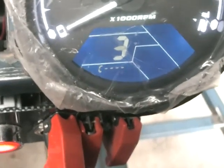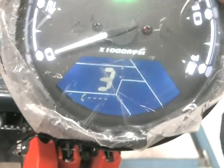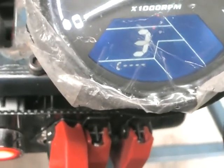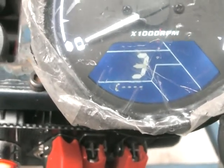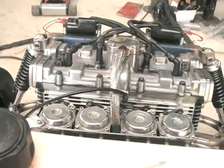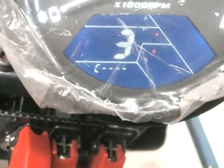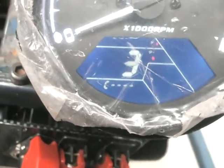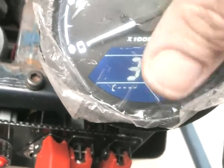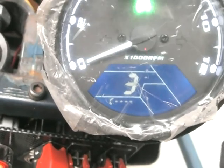Mode 3 in the instructions says 'tyre rotating speed', but what it really is is the engine speed. It comes on one. If you've got a one-cylinder engine, do not touch this — if you change it to something other than one, it won't go back to one again. In my case, I've got a four-cylinder engine but I've got two coils, so it's sparking as though it's a two-cylinder. Your options are one cylinder, two cylinder, and four cylinder. You need to pick this correctly in mode 3 to get your engine speed right. When I first set it up, I had four cylinders instead of two, not remembering that I had two coils, and the tach reading was only half of what it should be.